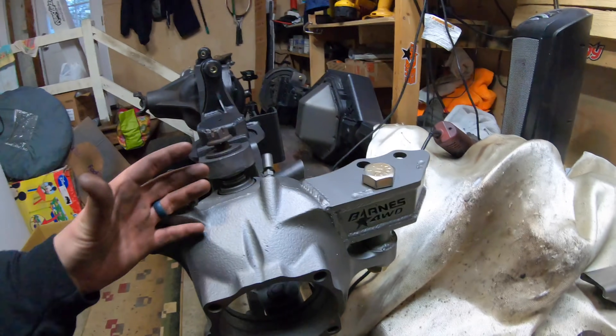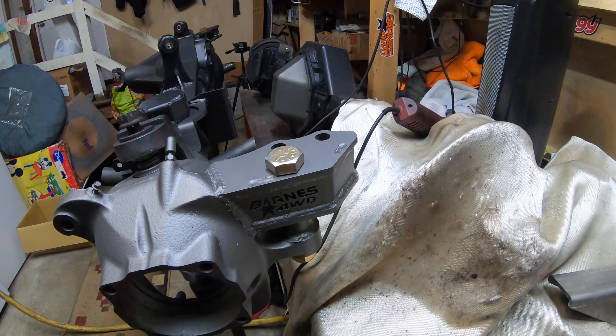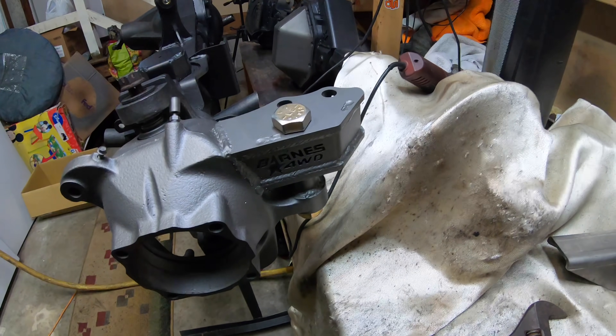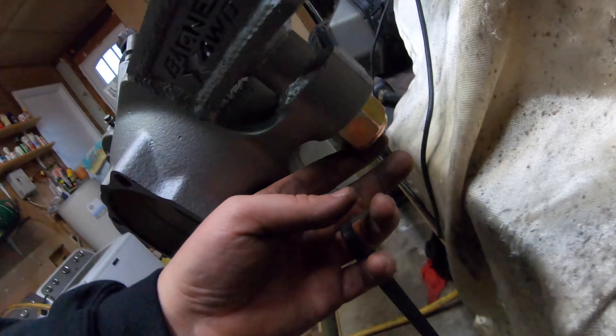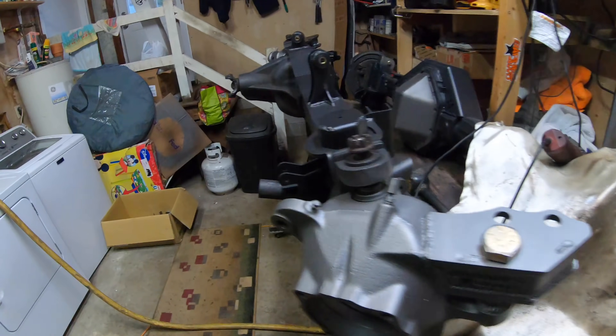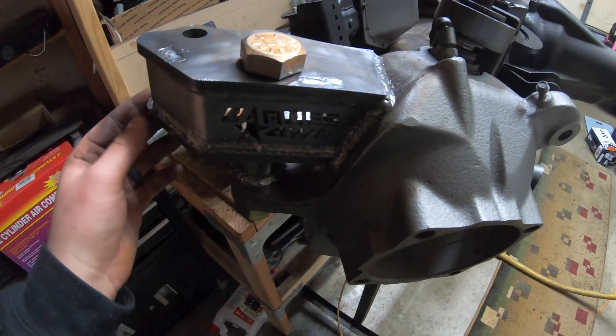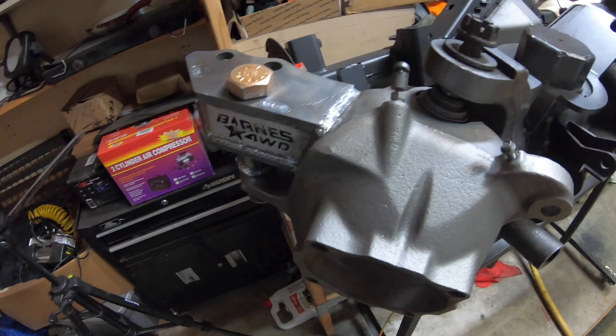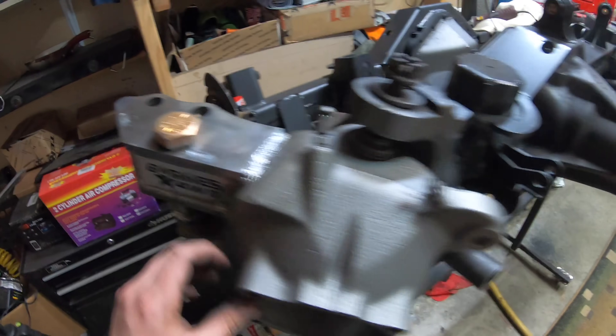Once the welds cool down nice, go ahead and torque this bolt down. You don't have to get it crazy tight, but definitely snug it up. It has a nylock nut so that's not backing off. It's done and looking really good. I still have to go paint this side, but I'm very satisfied with the outcome. Everything turned out really nice - I'm happy with the welds up here. I did two passes: a little root pass and then came over and made the final pass. We are one step closer to getting our axle under the Jeep - still a lot more to go. Thanks for watching guys, give this video a big thumbs up, subscribe to the channel, and stay tuned for more videos. Peace.